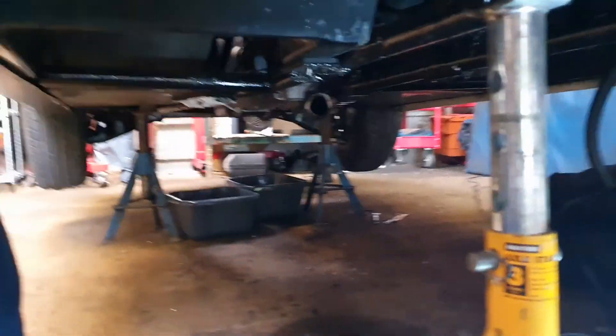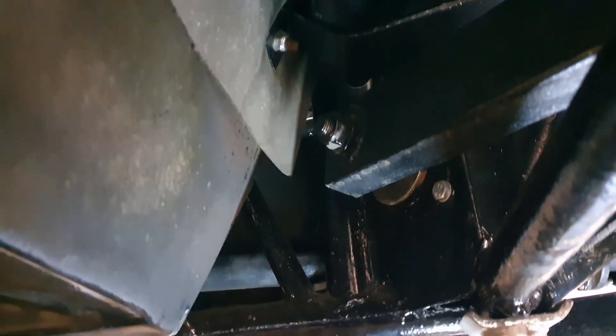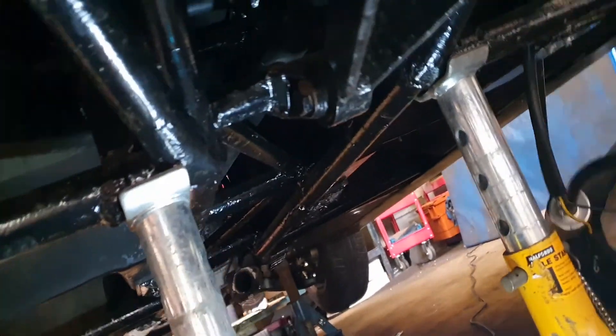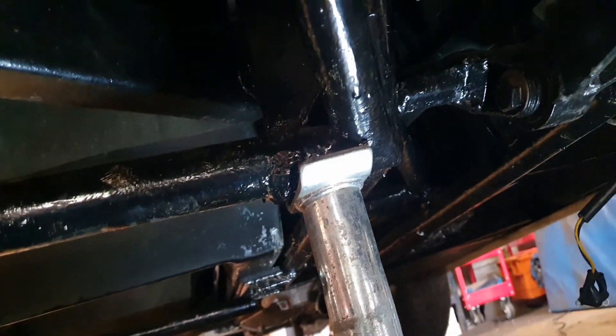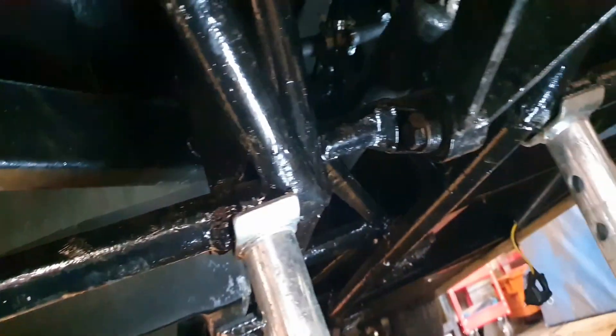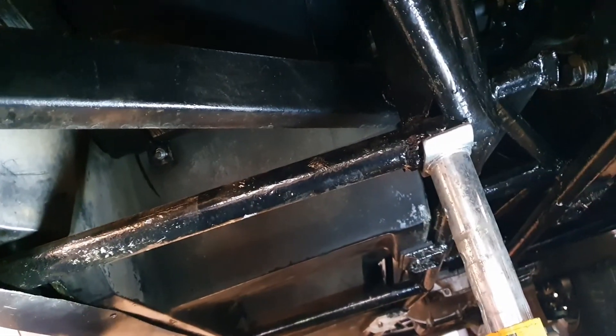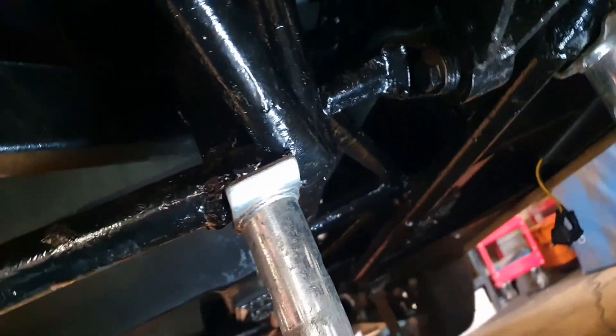Much more strengthening is needed. A couple of things were pointed out by my student colleague Stuart: the trailing arm inboard mounting points are just single shear, and they're packed out with just washers and random bits of metal. It's not the most robust design I've ever seen in my life, if I'm honest. I'm thinking with the amount of torque produced from something like a small or even a large Tesla drive unit, strength is going to be of the essence.